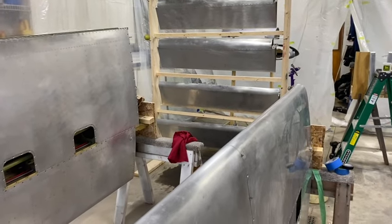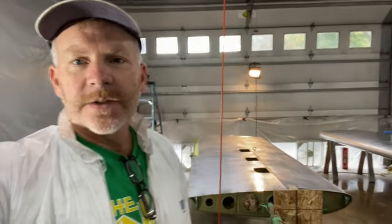I have all my striping mapped out — I'll show you how I did that later with some still shots. I've got lots of parts and pieces, things like cover plates, and all my screws are screwed into a board so I can spray the board and cover all the screw heads. Those have all been prepped and are ready to go. I've got to finish taping up the seams, Scotch-Brite everything one more time, then wipe it all down, and I'll show you some painting from there.